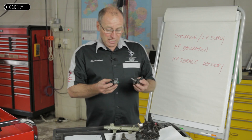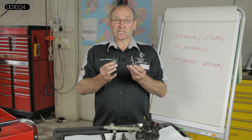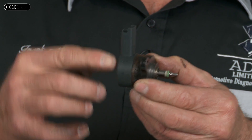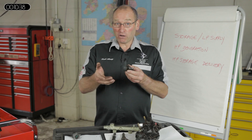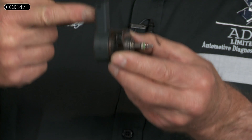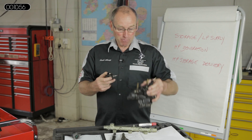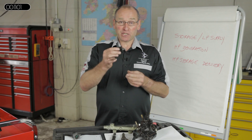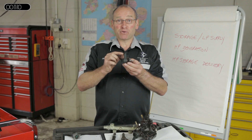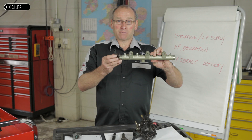I've mentioned the two types of control devices. These are both Bosch devices, but these types of devices are common across all common rail manufactured systems. First, the pressure regulating valve or DRV — it's a coil, therefore a solenoid, controlled by duty, on-off. This particular device is ground switched — ground is on. On means it will consume current, which means it will drive the valve in, and that closes the escape route. So as it's driven in, it closes the escape route, which invariably then allows the pump to increase pressure. It's a duty control valve, and within this part of the assembly is a needle or valve device which restricts the escape route of the fuel. Pressure regulation can be built on the pump or on the back of the rail — the location may vary.